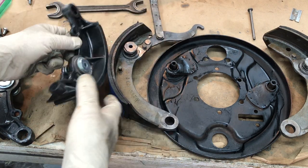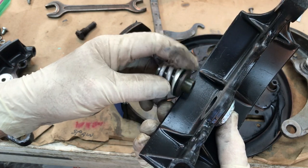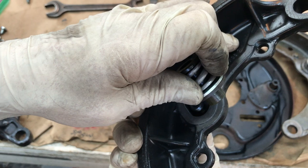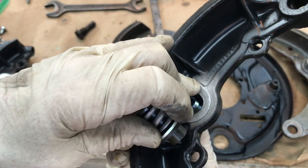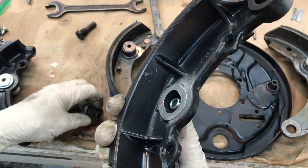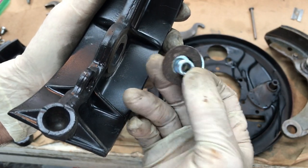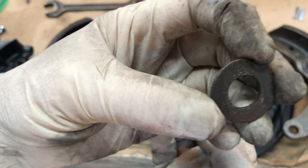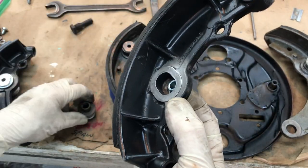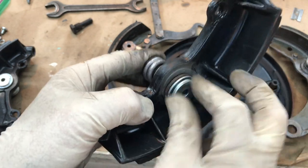To make this work, you have a spring, a washer, and a friction disc. That friction disc sits on this surface — notice I cleaned off the paint so you have bare metal. You want friction disc to metal contact, and no glue, grease, or lubricant goes here. I've seen people actually lubricate these, which defeats the whole purpose. The friction disc material is incredibly hard but very brittle — you could snap it easily — but in compression it's incredibly durable.